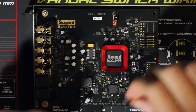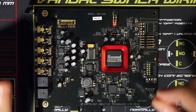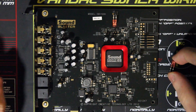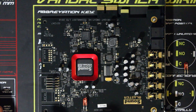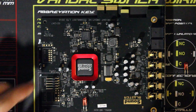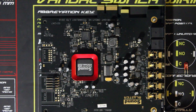The LED is off now. You can keep them for future projects. Also, if you're going to RMA this, you could theoretically solder the LED back on and send it in, although I'm not entirely sure if they'd notice — so that's at your own risk. We're going to place the LED aside and do the same for the other one. I'll flip the card around for this one. Same procedure, although this LED has the capacitor right beside it — it's a very small capacitor, so be very sure not to nick it. Place the wire cutters at the base of the LED at the prong and cut. Same for the other side. Didn't come close to that capacitor at all, so you should be entirely fine provided you follow this guide correctly.